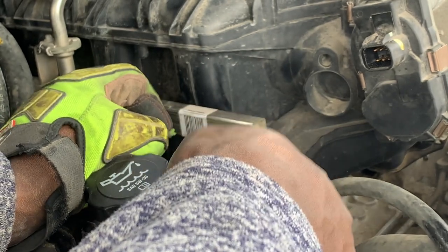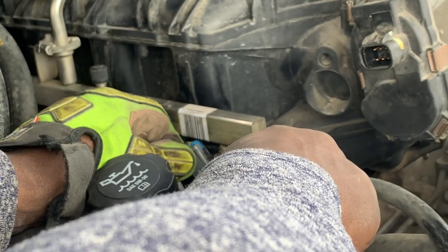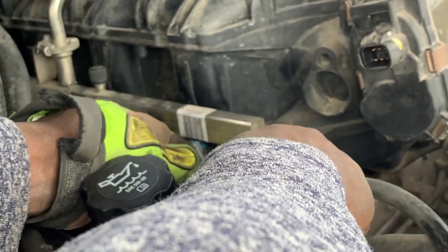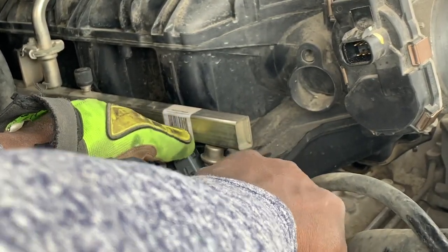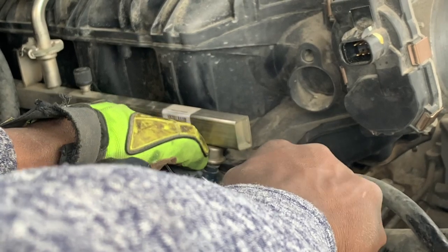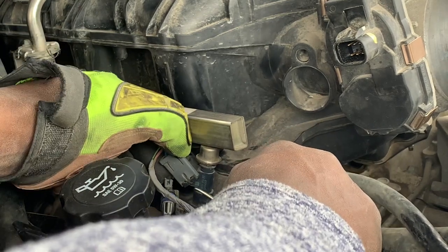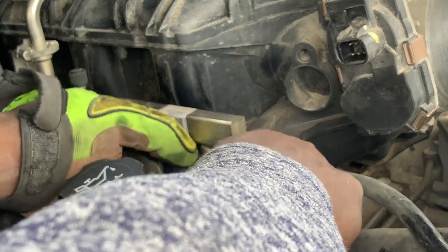But this black clip — a couple of things can happen, it can get stuck. There's a black piece on the bottom of that clip that needs to get pushed up. I suggest you use a hook and get underneath that black piece — you've got to feel for it. You can turn the injector to whatever direction you need to push up on the black piece. Get lodged, push up on the black piece, and once you've pushed up on it, pull the gray piece. So push up on the black and pull. You're pushing up on the black piece at the bottom — I'll show you when it's done.